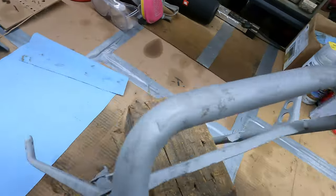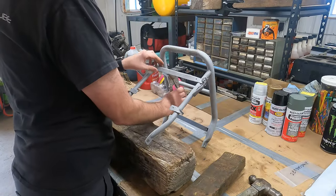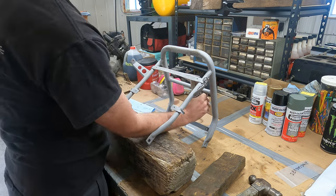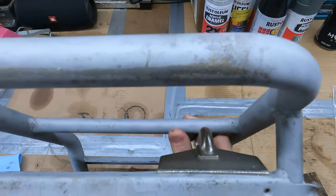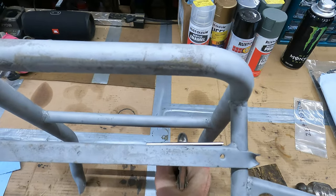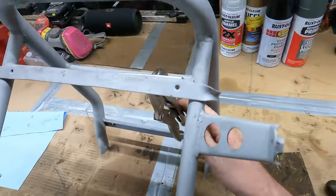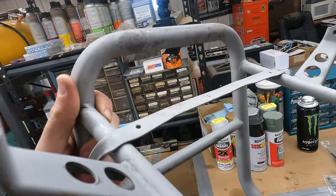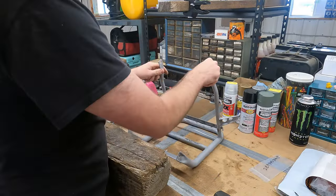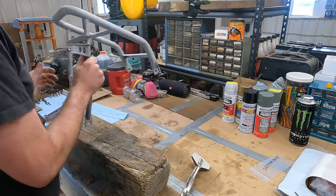So that got me a lot straighter this way. It kind of buckled a bit — I'm going to work on getting some of the waves out of that, but this is actually coming around pretty decent. I bought these really big duckbill type channel locks originally for doing tires because they're really good for holding onto the bead of a tire, but it's working super good on this. I've already gotten a lot of the twists taken out and it's coming along pretty good. I've got a little bit of waviness right there that I'm going to beat in with a hammer. I think that feels pretty good — I'm happy with that, so that's ready for paint now.